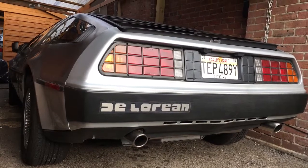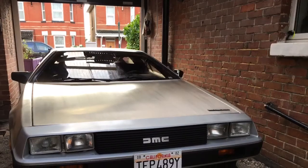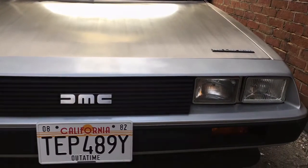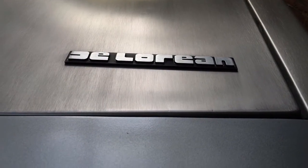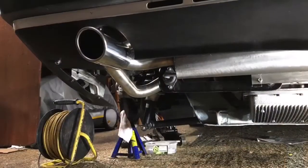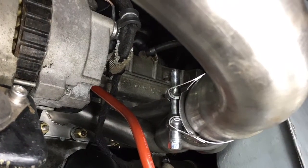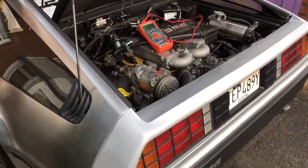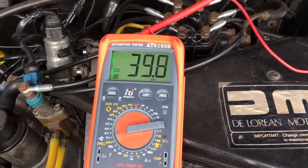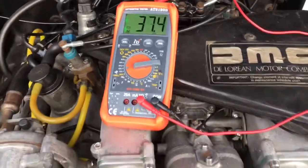The car's got a nice long warm-up now for the first drive. The readings are fluctuating — haven't changed the settings — and we've got a 33 to 39 on the dwell, which is pretty decent.